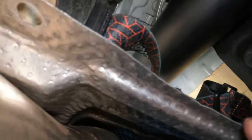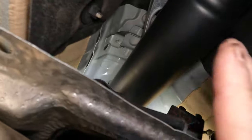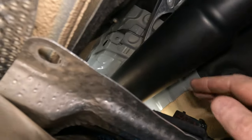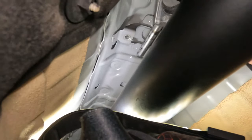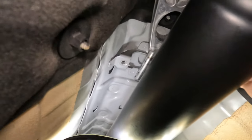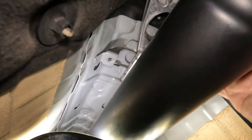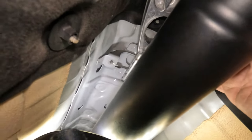I'm going to fish it out. Quick caution: the edge of your heat shield here can be very, very sharp — parts of this are just razor sharp. So you might want to wear gloves when you do this, or be very careful of this edge so you don't cut yourself. Here we are back underneath the car. All you're going to do is just slide the new bushing back into place with a little bit of high temperature grease, line it up with the bolts, and then put the securing bolts back in.